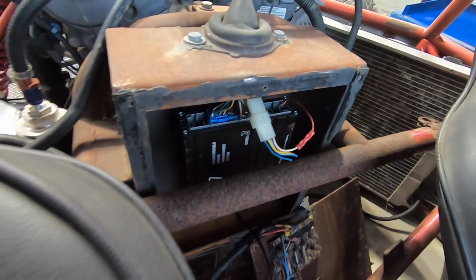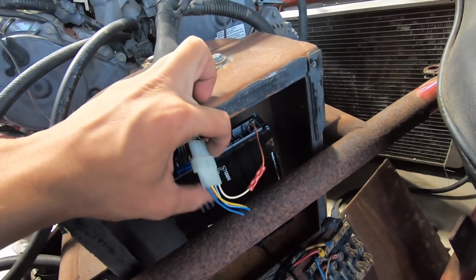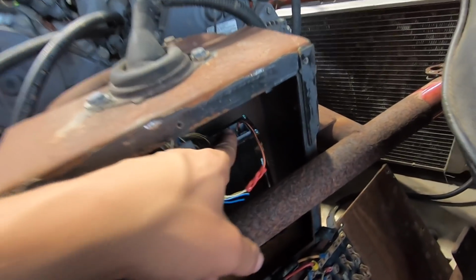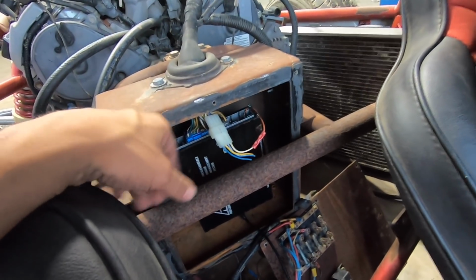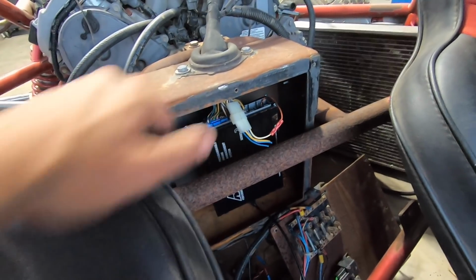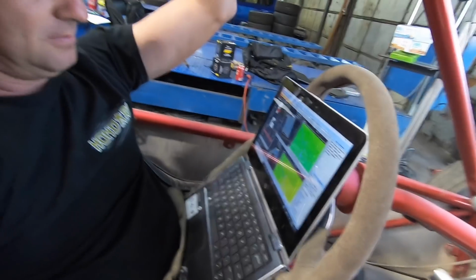Yeah. So we got the Series 2 ECU installed. All we had to do was take one of these wires from this plug that had the four on it and pin it to A15, which is the fuel pump output on the ECU, because without that, the fuel pump wouldn't kick on. But we got that plugged in, ready to go. So now when you hit the switch, you can hear the pump come on. So pump's going, and we loaded a tune up into it, and this is actually a 260 horse all motor tune. Yep, from a Civic that Brent did on another all motor J series Civic, so we're just gonna try that out. Might as well. See how she does.